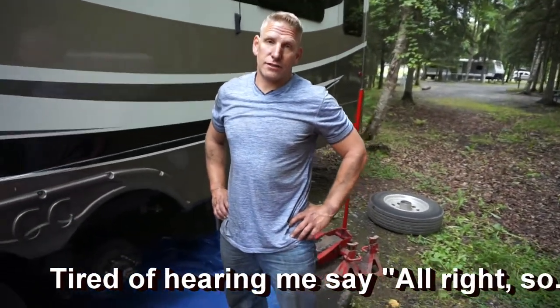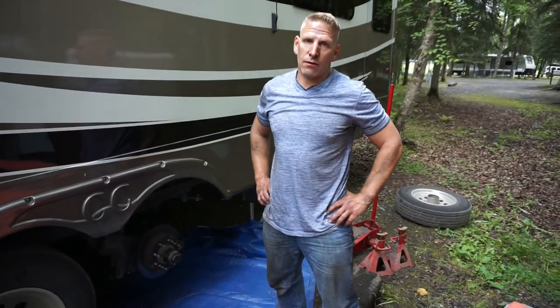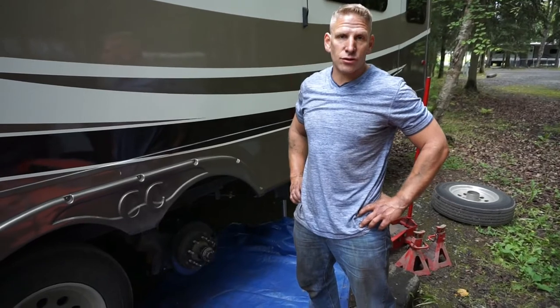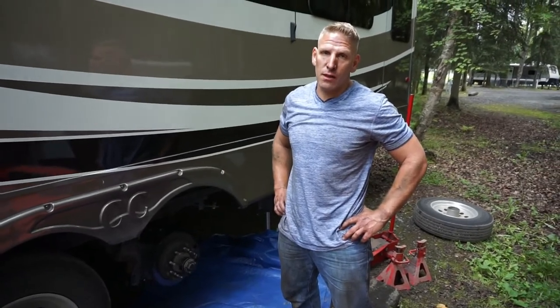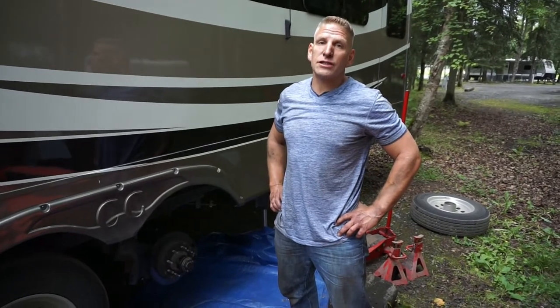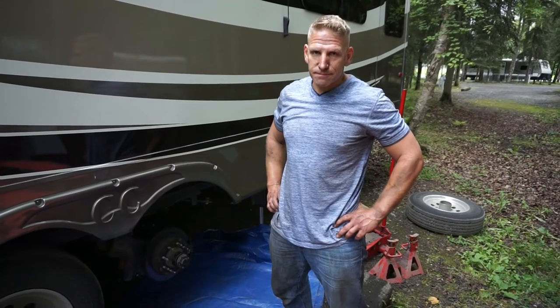Alright, so really once we got it a little bit started, it was just a matter of, like, the directions say, jack it up, bang on it, jack it up, bang on it, jack it up, bang on it, until you got it all lined up. And it wasn't really that hard once we figured it out. The key thing was loosening those 2 big bolts off the back of the torsion axle so it can move out and give you a little bit of freedom. And then just play with it. And it was much easier than earlier once I took those bolts loose.